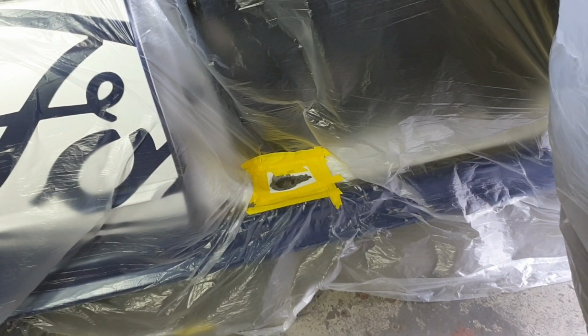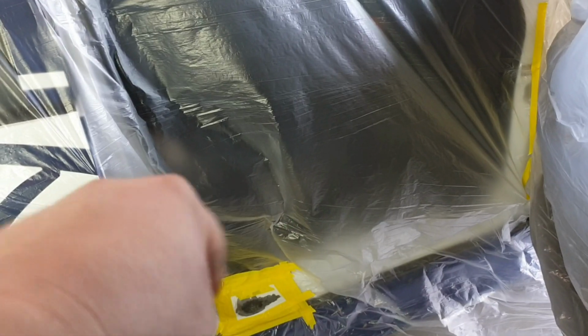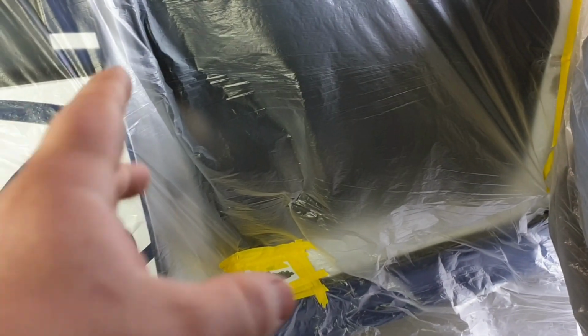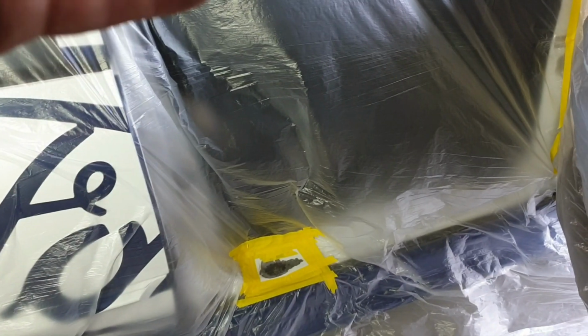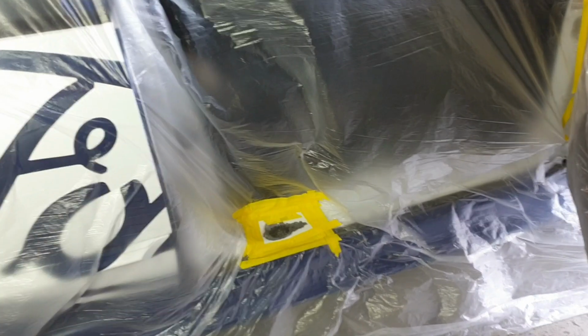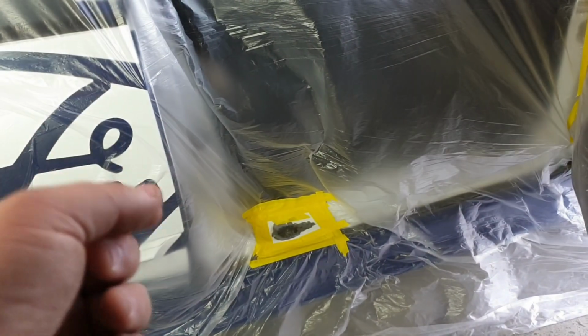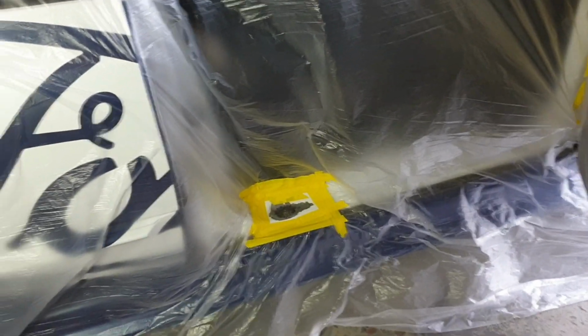That's rusted from the top in, not from the underside up, because the sill panel trim, the scuff plate, has actually scratched over time, and a bit of moisture's got in there, and it's eaten its way underneath the paint, but hasn't actually managed to eat through the steel. And just by the looks of the way the rust is working, you know that the inside of the panel isn't rusty, because it's top to bottom, not inside out.